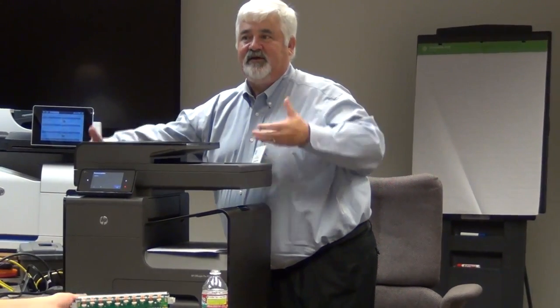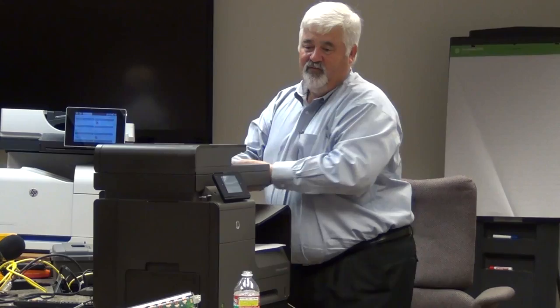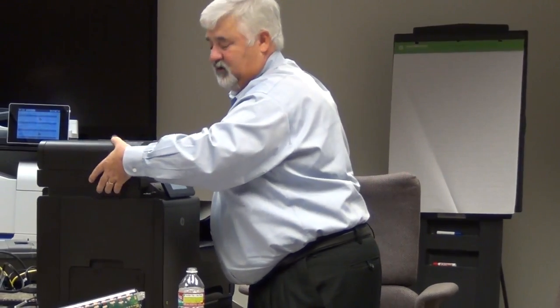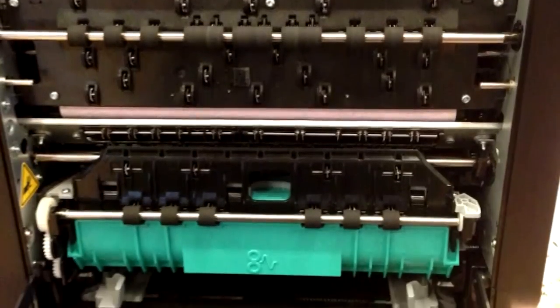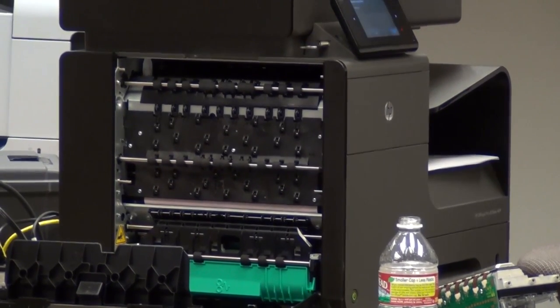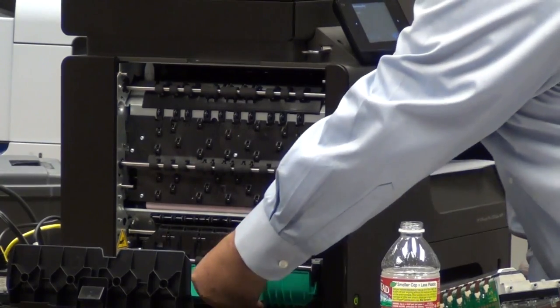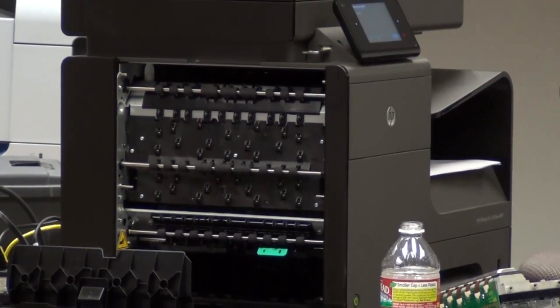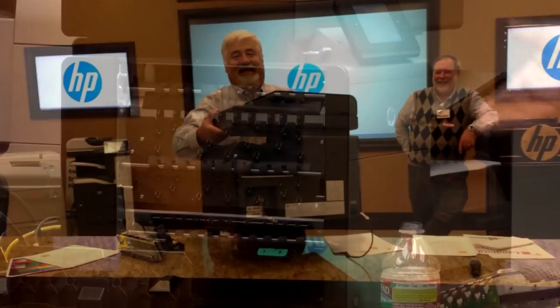While I'm turning this around, I want to show you something we designed in. Most people are worried about how to pick these up — you can pick this one up like this. When we talk to customers, they say they'd love to pick it up this way but are afraid they'll break it. So we made it so you won't break it. This is the paper path — the paper comes out here, up these star wheels, and out on top of the paper tray. Duplex is standard — the ability to print on both sides of the page is standard in all of these devices. The duplex module is right here; the page comes up, is held in the device, then rerouted back down through. This is the whole print zone — and there's your paper jam access. That's it.